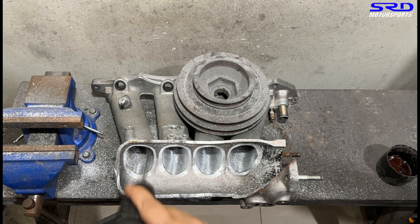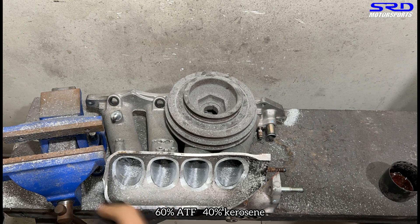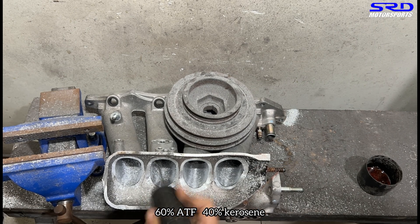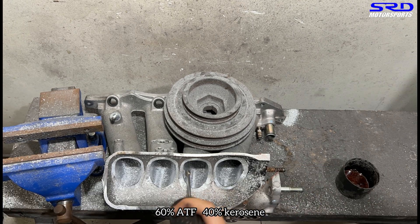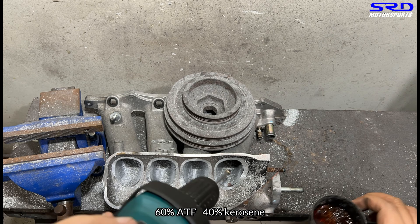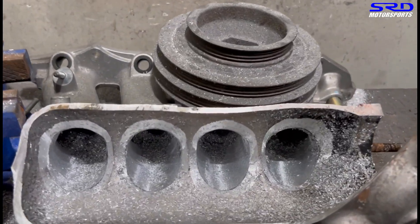Back to the normal pattern. As you notice, I lubricate the carbide with mineral spirits and WD-40 — other people say you don't need to, but I've noticed that every time you lubricate the carbide, you can run it without much pressure. You just run your hands through it softly and it still eats up a good amount of material. That lets you do it consistently without unwanted deeper cuts or burrs. So I always lubricate when trying to remove a lot of material — we remove it consistently without so many bumps.